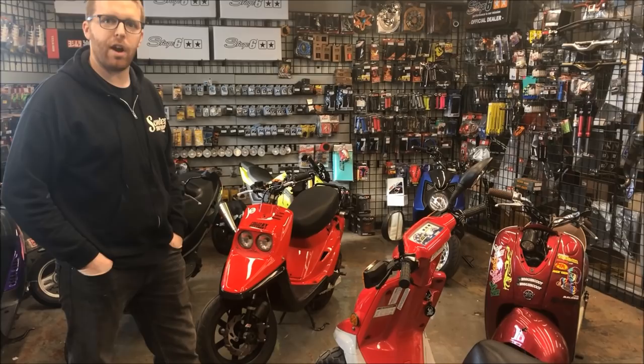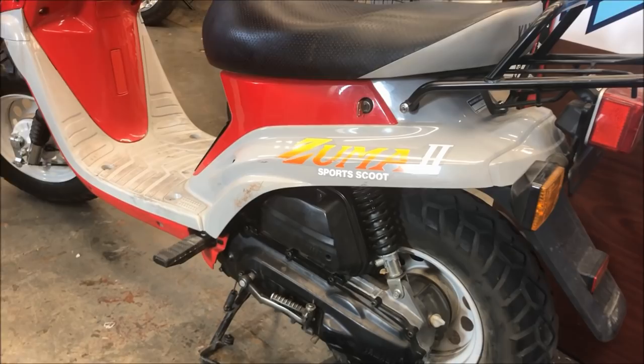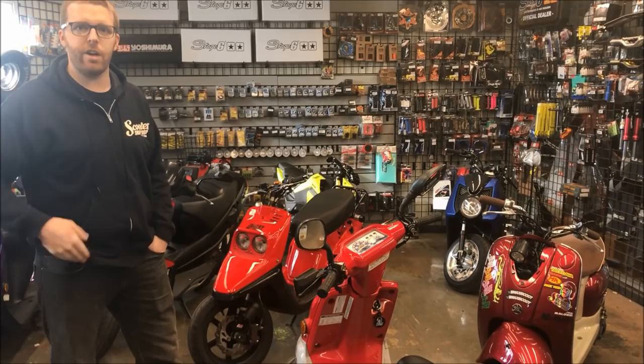So a pre-bug, especially a drum brake pre-bug, is going to be one of your best options. It's also a pretty easy bike to find in good condition. And my suggestion with any of these wheelie bikes, if you're just trying to learn wheelies, would be to learn on a pretty much bone stock bike. Maybe a little bit of transmission tuning or a better clutch, but not a 70cc with a tune pipe or anything like that. Any sort of peaky tune pipe is going to make the bike a lot harder to sustain slow wheelies.